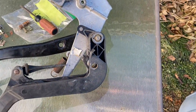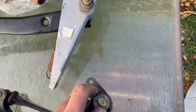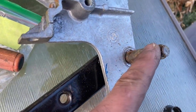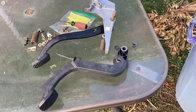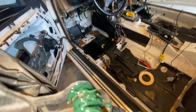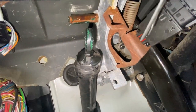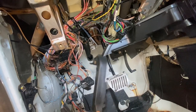There's a spring which goes onto this thing, and then you close the pedal with all that stuff inside. It has these little plastic bushings on either side. We're going to clean the whole thing inside the car, put bearing grease on it, put a little bit of bearing grease on all the components, and go put this pedal in.